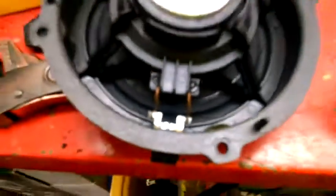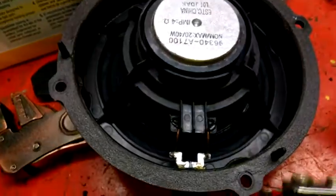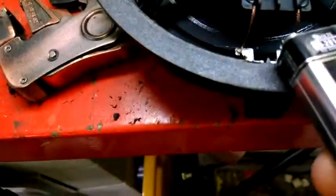So the way Kia set this up, let's just move this on the bench. They got bare wires going there, which actually works out very well for what we're doing. We're going to take this battery and we're just going to stick it on there and see which way it pops. The right way should be out. The wrong way should be in.